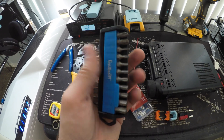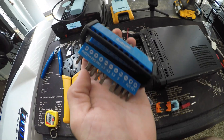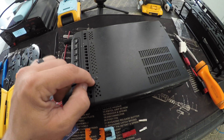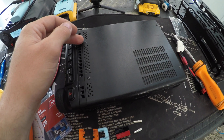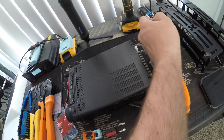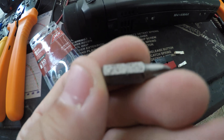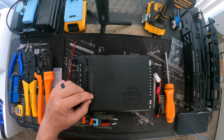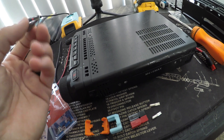For the bit set, I've had these for gunsmithing. You want ones that accurately match the screws - you don't want to strip them. These are pretty hard screws to find; some say they're Japanese Phillips and that using an American standard Phillips will strip them. I've been using a PH1 - it fits in and doesn't wobble, sticks right in there with decent surface contact, working totally fine so far.